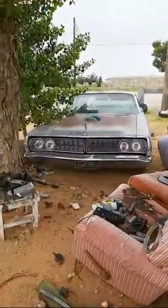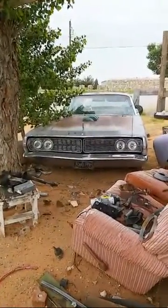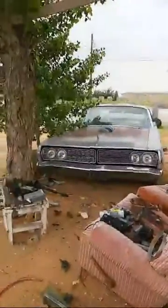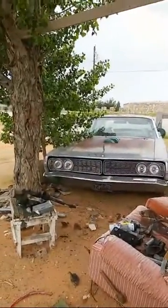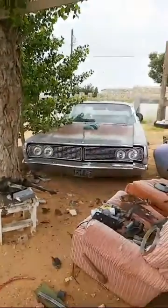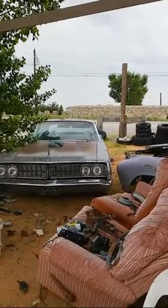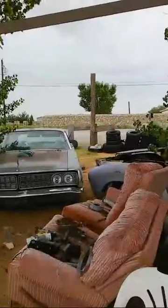This car is parked here probably until today, because every one of the bushings and all that stuff on the steering rack, like all the rubber on it, and the little ball joints that it has, it's all wrecked. So the car's a death trap right now. It runs good and everything, but it's a death trap. So my bro's just gotta order more of those parts. They're expensive. They only sell them at this company, Rare Parts, or we haven't been able to find other ones for the 68, for the steering arm and all that, for the idler arm. He needs the idler arm, and he needs the pitman arm. And then we already did the tie rods from one end, but we're gonna do the inner and outer tie rods from the other end.